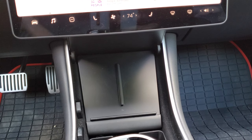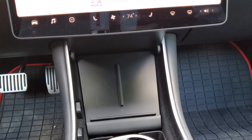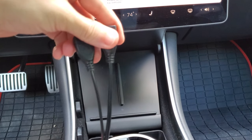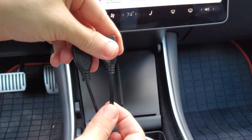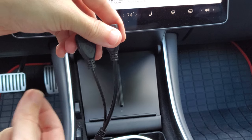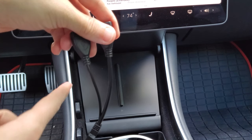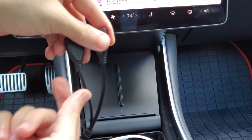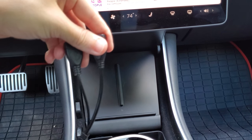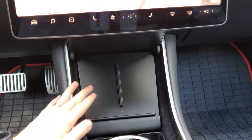It's been over a week. One thing I wanted to mention that I didn't cover during the install — the splitter that it comes with has two different size cables. The one on the right is thicker — that's the data cable; the thinner one is the power cable. The charging pad needs to be on the thin one, and if you use a USB for sentry mode or music, make sure it's on the thicker one.